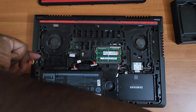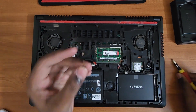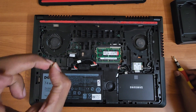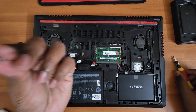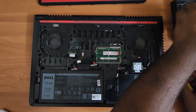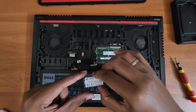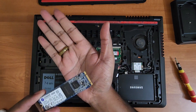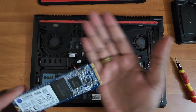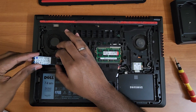There's already a screw in place for the M.2 slot — just remove it and keep it safely. In case your laptop doesn't have this screw, take one from a different part or use an old laptop screw. Keep it aside separately. Now take the M.2 SATA SSD. If you're confused about the notch gap, don't worry — it's an M/B cross-compatible SSD, and almost all SSDs available now for this older laptop generation are cross-compatible.